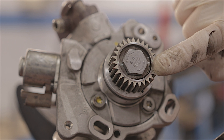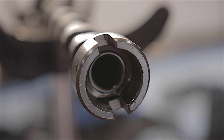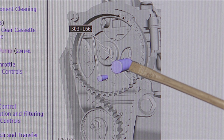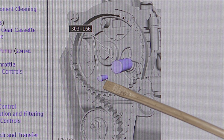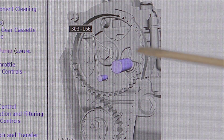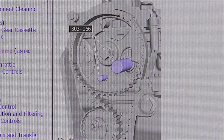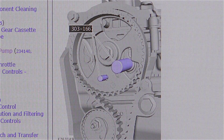Once you've lined up the two dots on this pump, the whole pump unit will dog into a separate housing with another cog in it. At the back of that housing there is a dog drive which slots into the rear of your exhaust camshaft. So on this Ford Etis system, you can see that when the camshaft belt is lined up, there is a pin to set the camshaft sprocket. There's also another timing pin for your high-pressure fuel pump, which goes through the camshaft as well. I can't quite understand why that's there when the main pin is holding the sprocket solid anyway. But if you notice at the rear of the camshaft there are just two slots, so you could potentially get the pump in with the camshaft 180 degrees out. Whether that would make any difference I do not know. But it's best to pin your camshaft sprocket up as shown in the illustration before you refit your pump, so you know it's going to be refitted in the proper position.